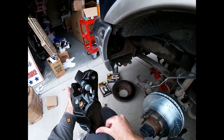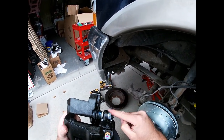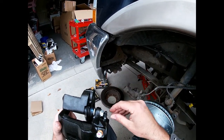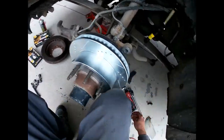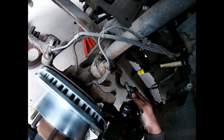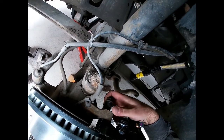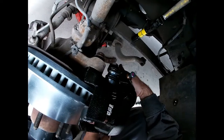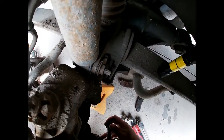This is a cylinder full of brake fluid, so you want to make sure that the bleeder is up so that when we go to bleed the air out of it, the air will rise to the top and we can get it out. This one actually has an 'L' designating left or driver side, so that's quite nice of them. Installation is just like removal — come in here, line it up, lower it down, watch your fingers. This is an 'ask me how I know' situation.